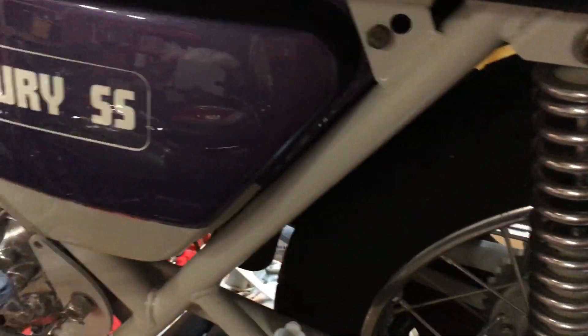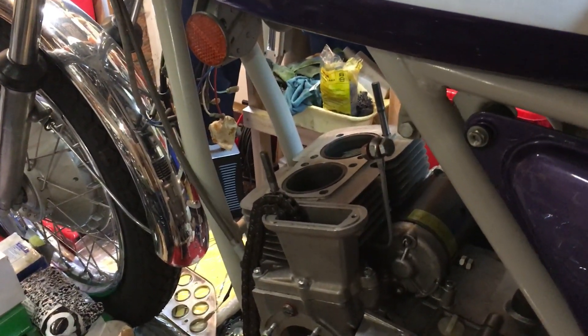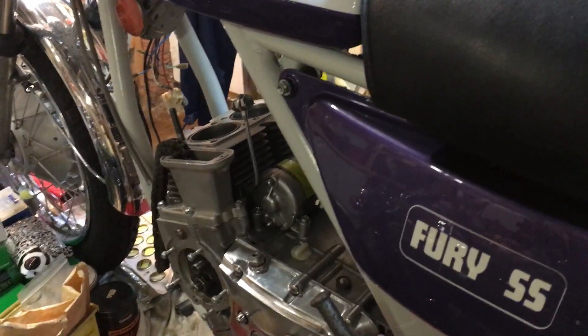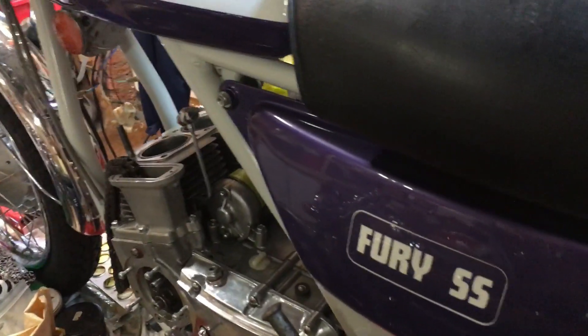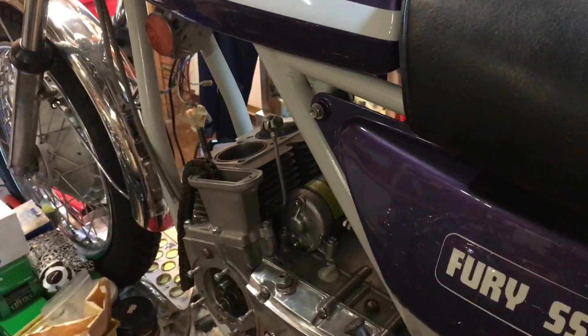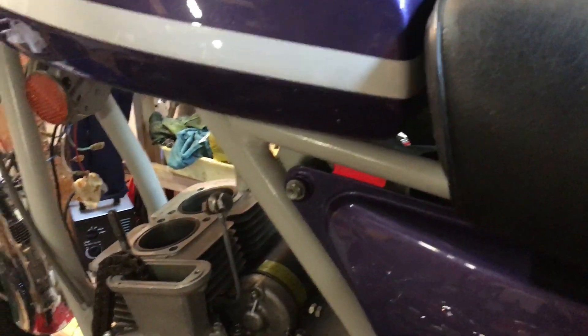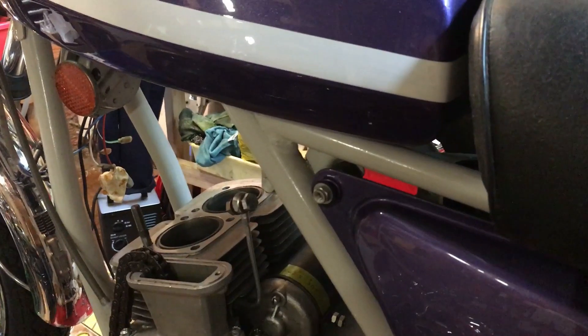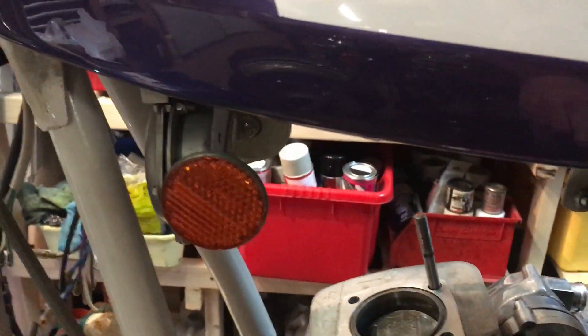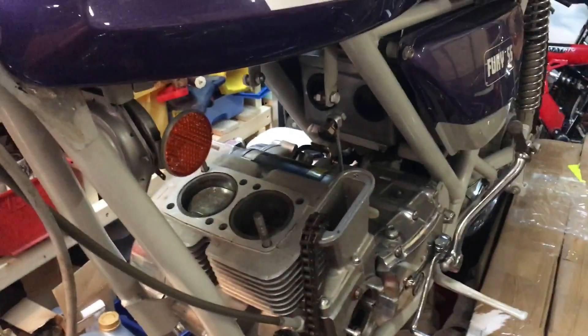So that's the plan. Once that's all done, the final thing would be tank off and finish the wiring - that's always the last job. The rear loom is unique to the bike but pretty standard with respect to all the electrical components. I do have looms from that area for the big twins, and what we're going to do is what we did on the Bandit - offer it up and basically hack the front off where we need to splice the rear harness into the front junction block under the tank.